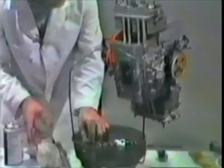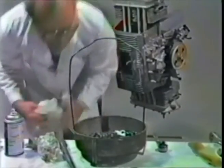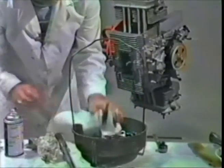It helps to use the old big bore kit box. Again, it comes in handy for lots of things. You grab a new paper towel, and you grab, say, 4 push rods, or you can use all 8. Take a can of WD-40, put the nozzle into the oil hole of the push rod, and blow it out until what comes out is clear WD-40. We've cleaned all these in a nice benign cleaner, so they are fairly clean now. You've got to blow out the old cleaner and any other crud, make sure the passageways are clean, and that you have a complete connection between one end of the push rod tube and the other.